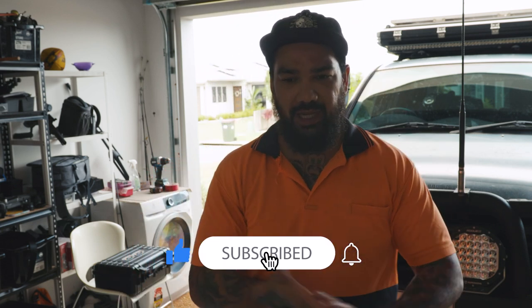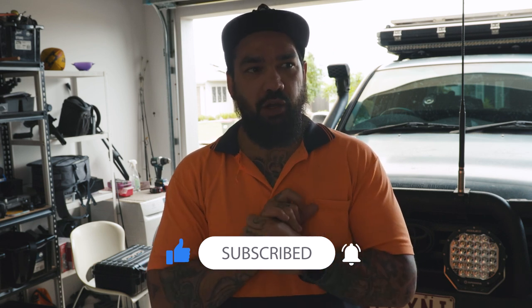Welcome back everyone to another episode. We're in the shed today on this journey of rebuilding the car, getting it back to a bit of former glory after Cape York kind of destroyed it. So today I'm going to put a bonnet scoop on. I have reasons for this - I have heating issues. It's nothing major, the car still runs fine, but I noticed once when I was towing a boat trailer up a hill that the car just wasn't getting enough air into the motor for cooling. I don't think the engine's overheating, it was just the engine bay was really really hot.